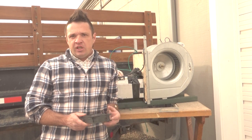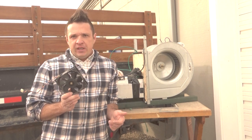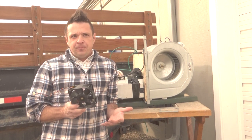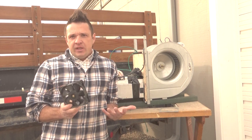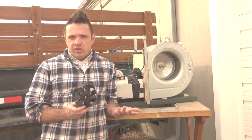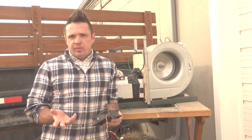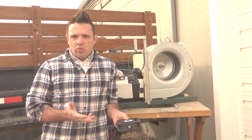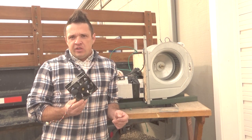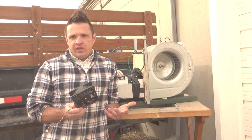The fans used on the miners seem to be pretty much all standard. They are 120mm pulse width modulated fans. How they work is the miner sends a chopped DC signal to the fan, and based on the frequency of the pulse width modulated signal, that determines the speed of the fan. It also receives a signal back from the fan to know the actual speed it's turning at. These fans consume about 36-40 watts and are 12 volts DC, putting out about 280 CFM of air.